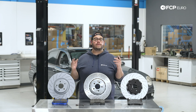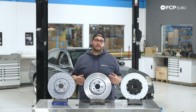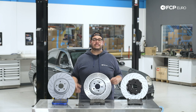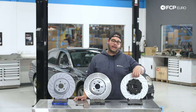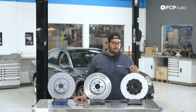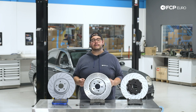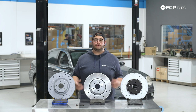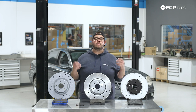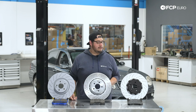A couple of things to look for before you get started is inspecting your brakes visually, seeing what kind of condition they're in, seeing how much meat is left on your pads. An easy way to tell if your rotors are going bad is simply by running your fingernail across the face. If you have a lip on either end, inboard or outboard, front or backside, more than likely they're probably worn. In some extreme cases you'll get some pulsating in your brakes when you press down on the brake pedal, especially under heavy braking. Just keep in mind that worn out front end suspension components can cause that as well.